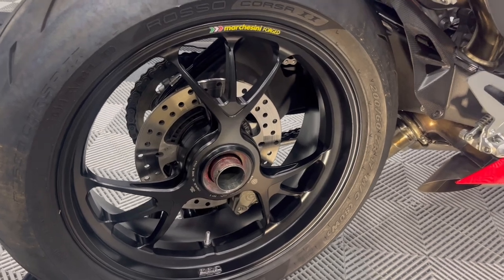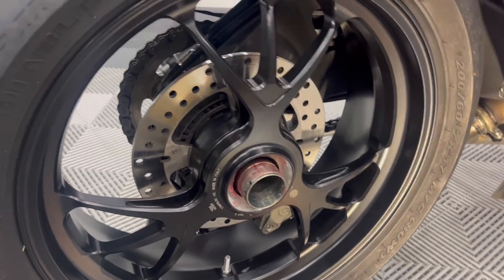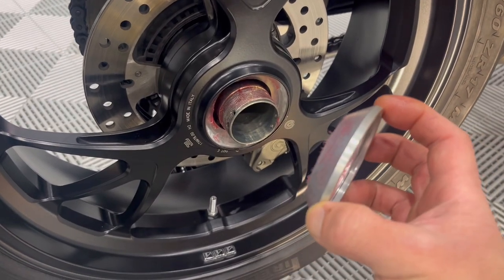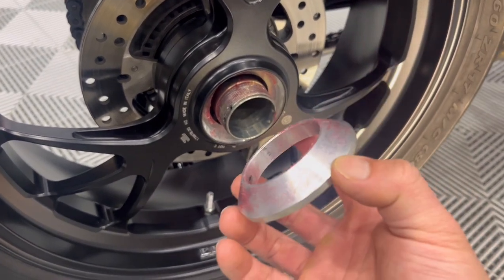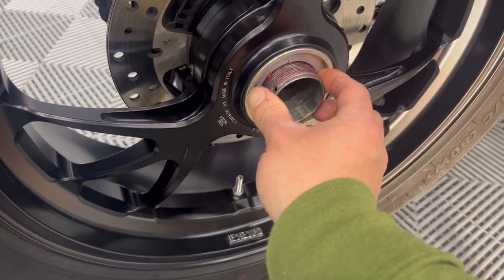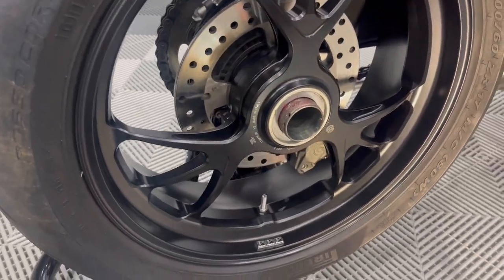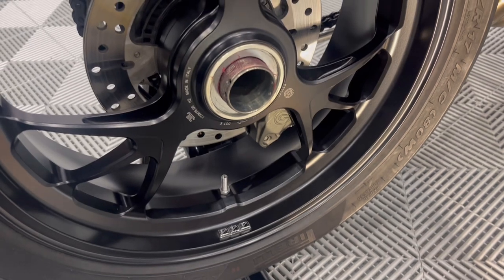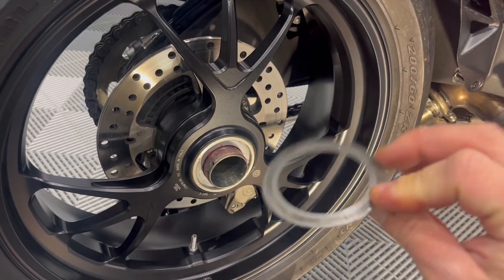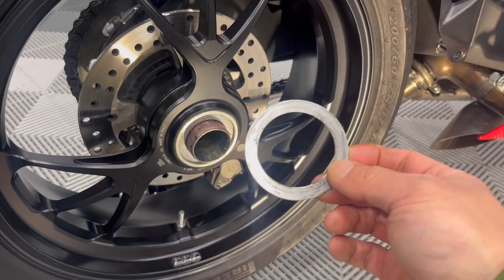There's the rear wheel installed. Once you get the wheel mounted again, put a little bit of all-purpose grease in there — they even make specific motorcycle axle grease, but either way is fine. Don't forget your centering cone — I don't know the actual technical name for it, but it basically centers the wheel for you. Make sure it's nice and clean; I put a little bit of grease on it just to keep it from seizing. On these bikes there's also this little spacer as well — it's like a really thin washer. Clean it a little bit and put a little bit of grease on it.